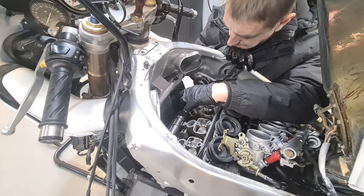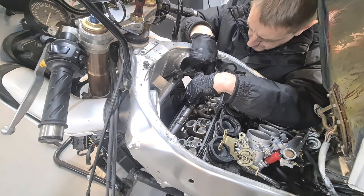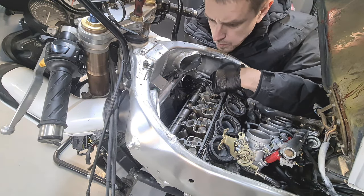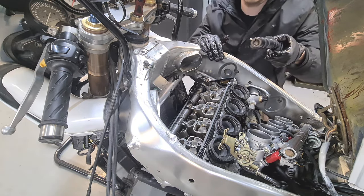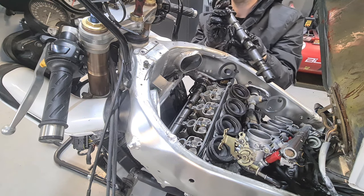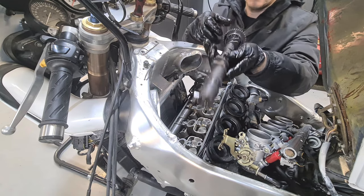So I'm first going to drop it into position. Fit our chain on. Right, on the other cam, that notch or slot, which we'll call it, points up, and you want the number, where are we, there we are. The number one facing down and the two pointing to the radiator. That's for this one.